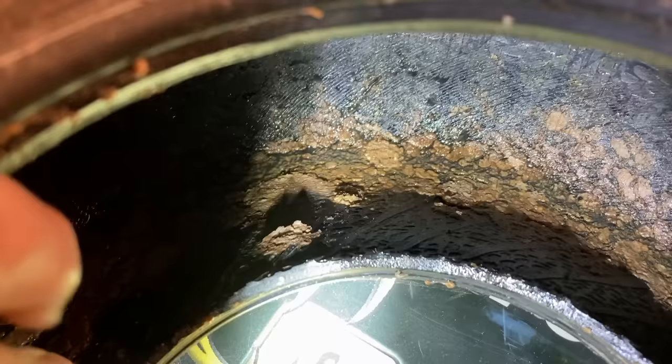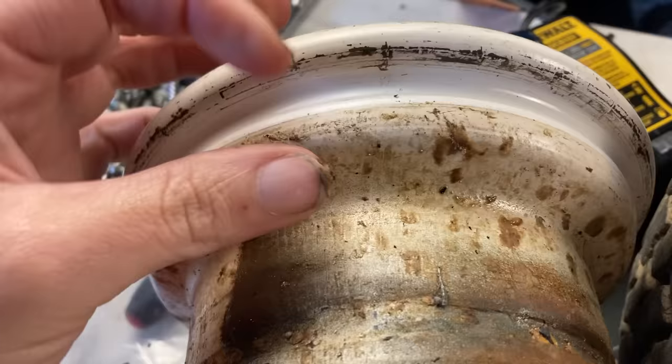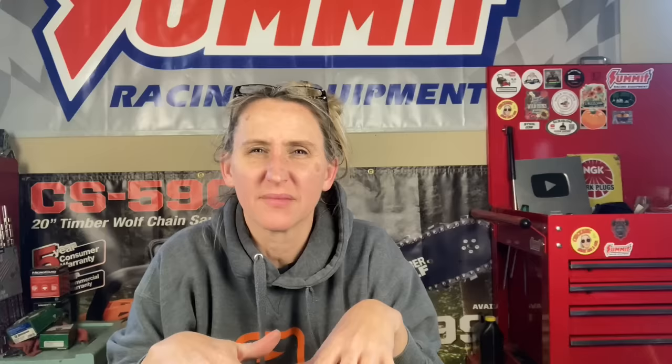This is the inside of his tire, and that is Fix-a-Flat. That does not come out — you can't clean that out. Let me show you how hard this stuff is. There's a chunk I just had to rip off. It's gross — look at that nasty sticky stuff. Here's the rim, and all of this brown stuff you see is this sticky gum-like material that you cannot clean off. Carburetor cleaner doesn't take it off at all.